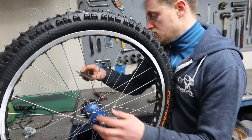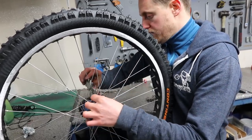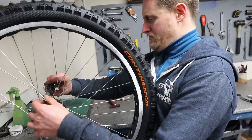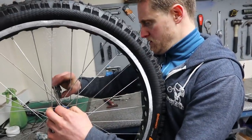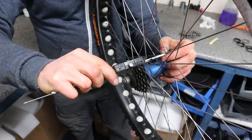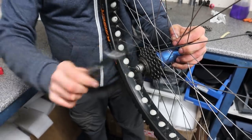We measured 47.5mm, which is pretty common for a trials bike with a wide bottom bracket. Then we find the middle point of the rear hub and work out that same distance — that's where your sprocket goes. With the hub being 135mm wide, the center is at 67.5mm, which from memory works out pretty much bang on one of the logos on this hub — a nice little helper. So measure 47mm from there and you want to be pretty much where that current sprocket is.